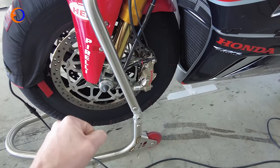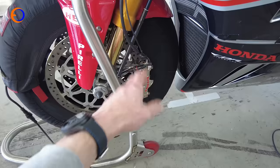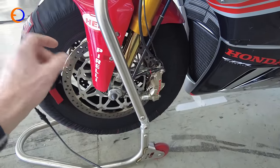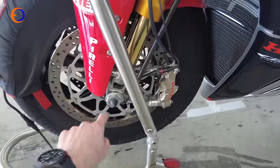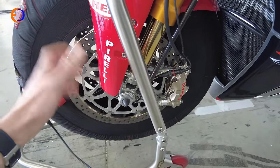Compared to the Superbike Franco rode last year when he rode for Honda, we haven't got the Nissin brakes - we've got Brembo. We've got the HPK monoblox on 336mm diameter 6mm discs. The centres, to fit the OZ wheels with the offset we wanted, are actually bespoke to us, and the Fairburn team have got them as well.